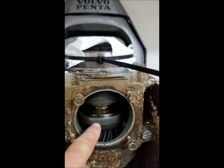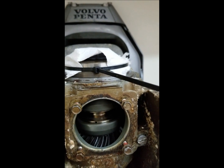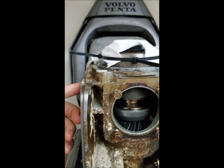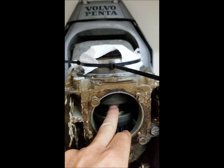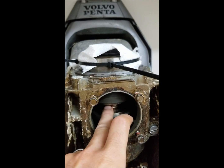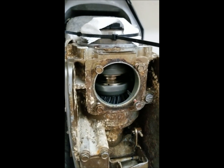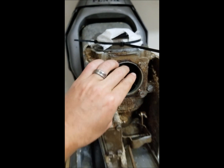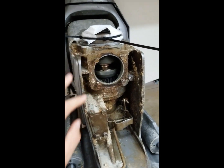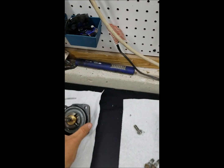What we've got here is the forward gear and the reverse gear. There's a pinion that comes in from the back from the engine. This here is your clutch — it rides on a vertical shaft. You can see it sort of helixes as it goes up and down. The vertical shaft goes down to your lower unit and drives the gears down there, which drive the prop.